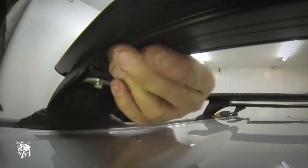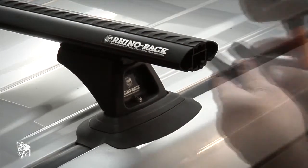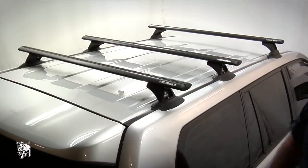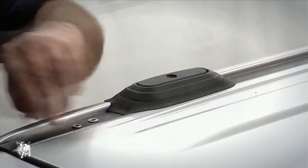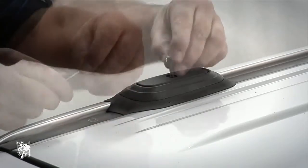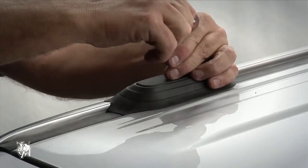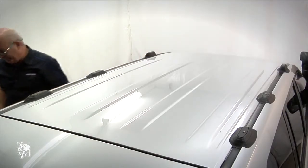Measure, cut, and fit the underbar strips as required. Insert the end caps completely onto the crossbar. The Toyota Prado aero bar is now ready for use. If the crossbars are not in use and removed, you can use the mounting pad covers to seal off the mounting pads. Place the cover over the mounting pad and secure using the M6 security screw and washers. Use the supplied 5mm security Allen key to fasten the mounting pad covers, then continue to finish off the other five mounting pads.